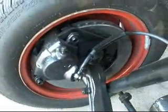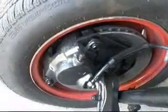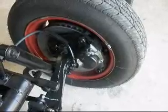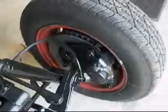I bought a Speedway disc brake conversion kit and put it on here. I really like these — now it's got some good brakes. Being my axle was a homemade setup, my shocks are on the back instead of the front, so I had to put the disc brakes on the front of the rotors instead of the back. Had to swap them, switch sides and come over. They worked just fine that way — really good setup. The only problem is the seals are really hard to get in the back. I boogered up three of them, so I suggest you order a couple extra seals just in case.